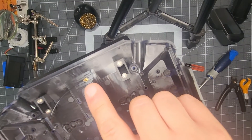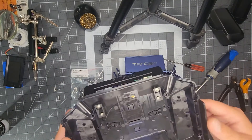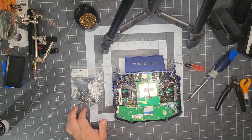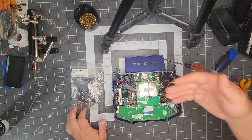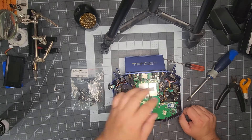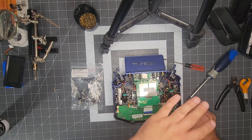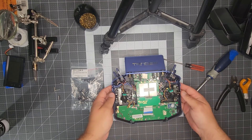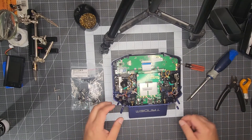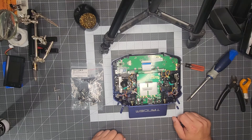This is the 900 megahertz antenna that you've got to be very cautious with. We will remove it for this job. Just to adjust your gimbals and stuff, it's not really necessary to remove it — you can just turn the case 90 degrees and gain access. We've got the two sliders on the side; I like to just pick them up out of the case and get them out of the way. Prefer to work on one side at a time. These switches are not only wired a specific way, but they're also oriented with plastic keepers.